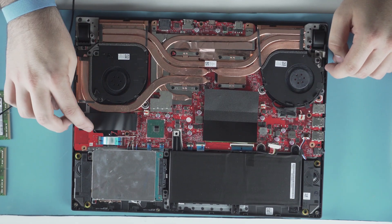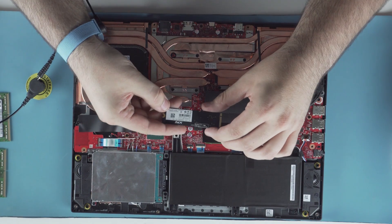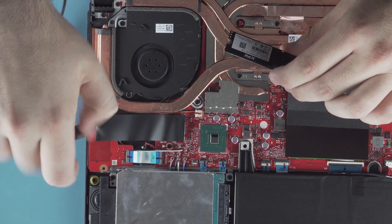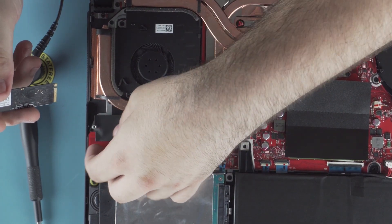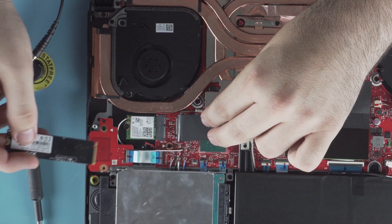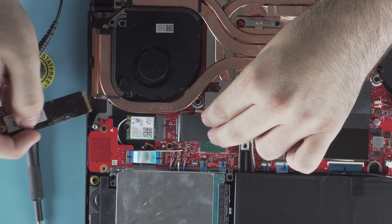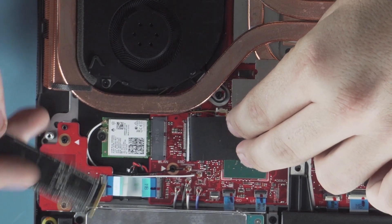This ASUS did not come with an NVMe slot stock, so we're putting in a 1TB ADATA XPG drive — should be a nice upgrade. Pretty simple: just remove this one screw here and get this piece of mylar out of the way. Under that we actually just discovered the Wi-Fi card. If you wanted to upgrade the Wi-Fi card, it's a simple process — there are two leads that need to be popped off and one screw. If you want to upgrade to whatever the latest Wi-Fi is, it's as simple as that.